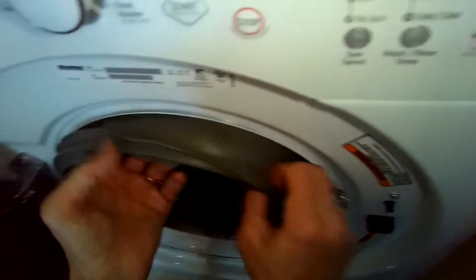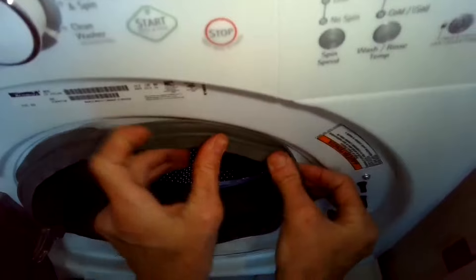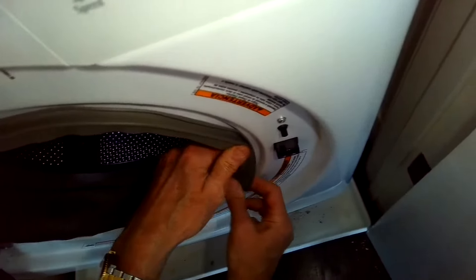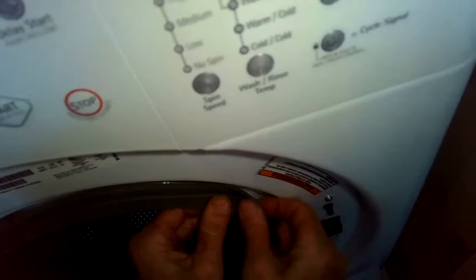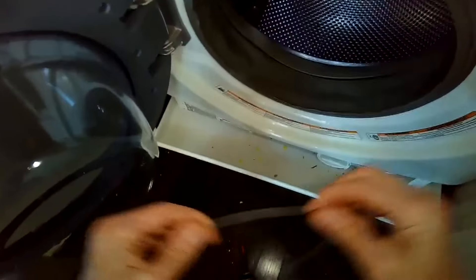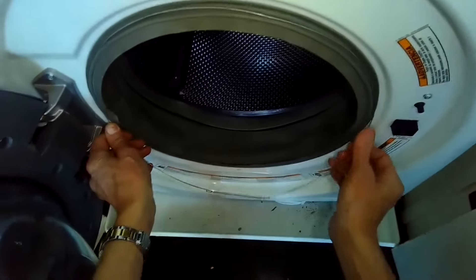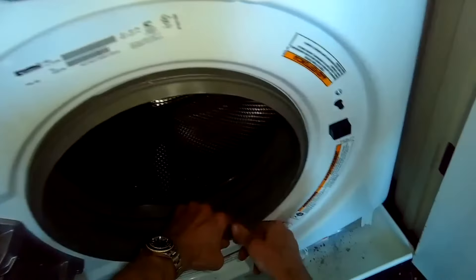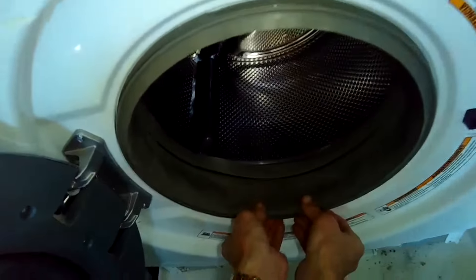Grab the gasket and pull it out so the rubber lip is out near the front panel. Use your thumbs to get that lip out over the metal lip and make sure it's really secure all the way around. Then put the spring ring, or spring clamp, back on. It's probably not good to use lubrication on the rubber, but it is good to put lubrication on the metal spring clamp itself. Put it on at the 12 o'clock position, put the spring down at the six o'clock position, then push down and pull the spring apart and over the six o'clock position — make sure it's really locked in and can't move. You can get another set of hands to help if you need to.